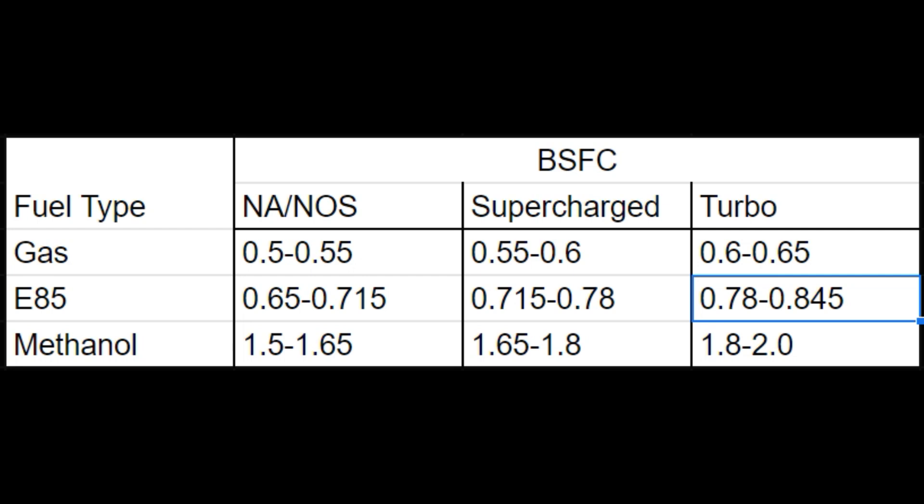As we saw in all of the examples, almost all of them exceeded the brake specific fuel consumption values in the table — these are values I found online that people typically recommend. All of them exceeded it except for my Cobalt, which is a bit of a weird example. So if I were to make recommendations, make sure you go on the high side of all of these numbers, maybe even add a tenth to it just to be safe. When sizing an injector, it's better to buy one set instead of two, because injectors are expensive and it's better to get them right the first time. Make sure you like and subscribe, and we'll see you in the next one.